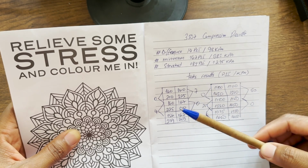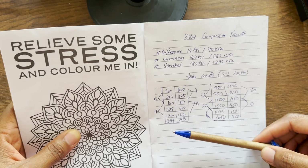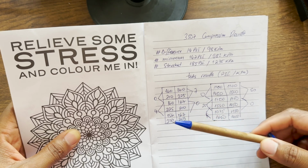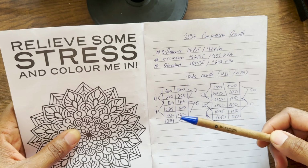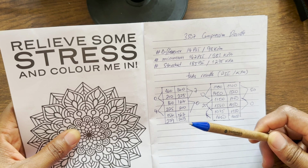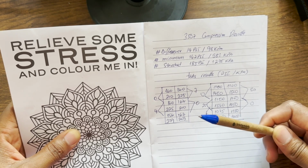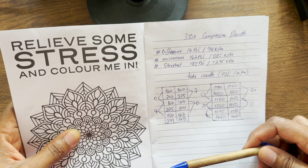So with this, I will conclude, and based on the test that I also did with the borescope to check the cylinder head, I can conclude that the issue with this engine is related to the valve stem seals, because I was also able to see how clogged in oil the valves were, which means that the oil was coming from the top to the bottom, burning all the existing oil that we have in the engine. So yeah,